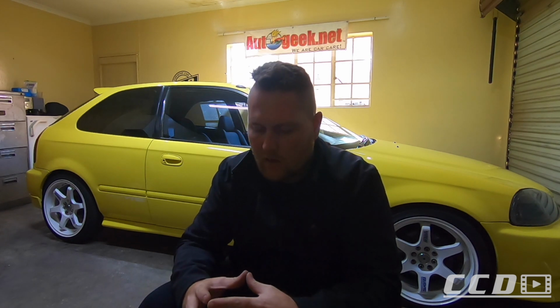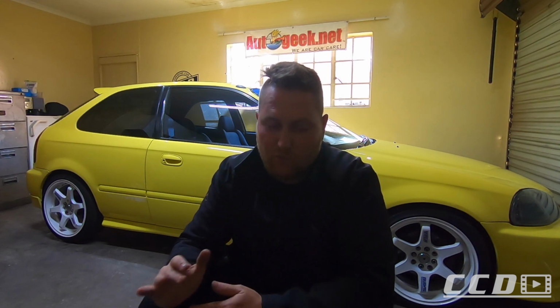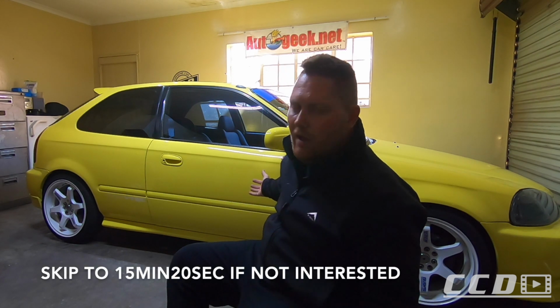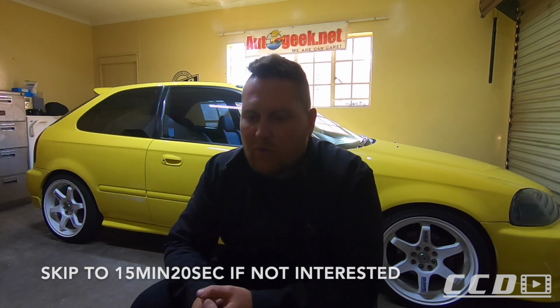As you can see, there's a lot of buffer trails on the vehicle, which is always expected after a respray, to be honest. The reason for that is, obviously after the spray work, the car needs to be flattened or sanded down to make sure that the clear coat is smooth. And then after that, they give it a polish, which they rarely ever have the correct tools, equipment and knowledge to do a proper detail like I would. So most of the time, they would get someone with a wool mop to run over the car and get it polished up like this. It looks great, unless of course you put lights on it, then it looks terrible.